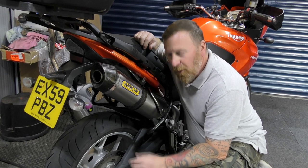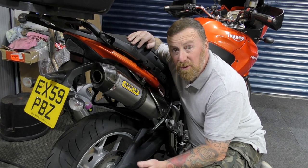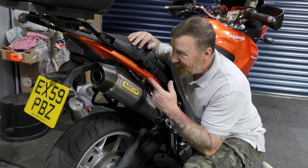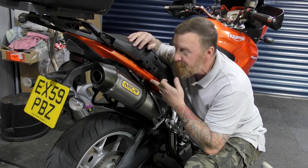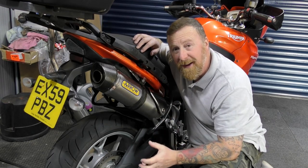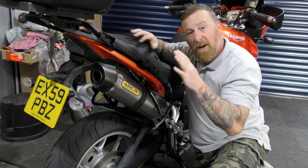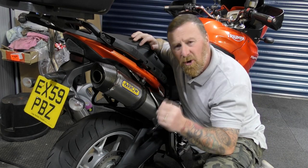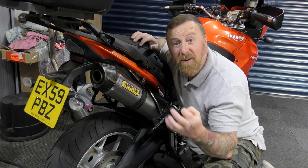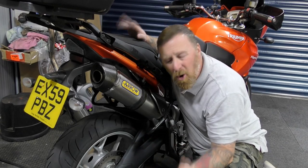Like all things, it wasn't straightforward. You've got to think outside the box - that little rubber piece could be a bit straighter. I had to take it off several times to readjust it, and then turned the bolt around because it was sticking out. I had to make a little bracket - practically wrecked it getting it back out to turn it around and put it on with exhaust paste. I also had to make sure it missed everything - pull it out because it was touching the plastic, check it off the stand to make sure it wasn't tapping. Please don't just slap on the exhaust and think you're done - check, check again.